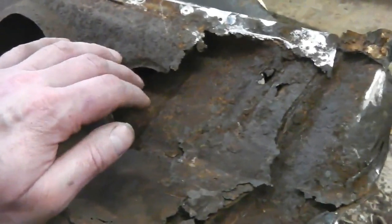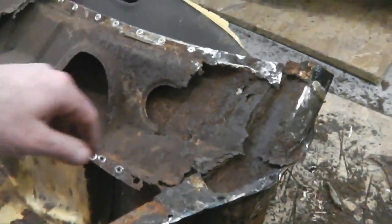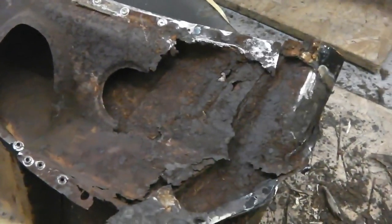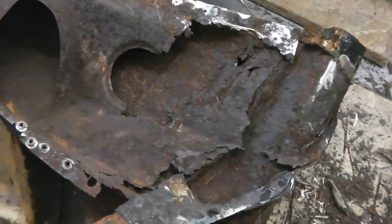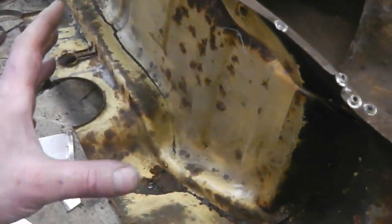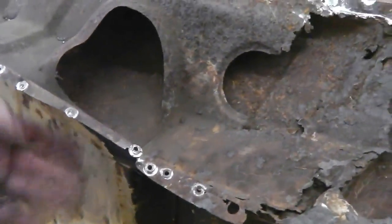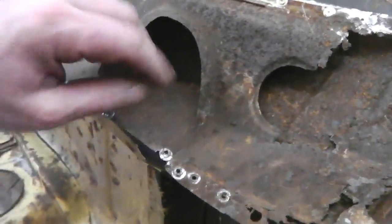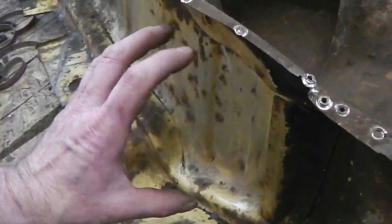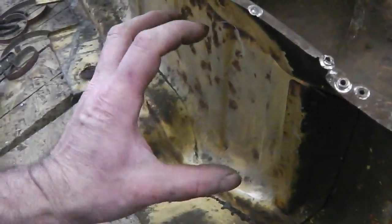So even if you've got good scuttles, you're still going to have the possibility that this inner panel has been eaten away. Now, you might not get any idea of that until you lift the scuttle. If you took your heater box off, here's your heater box in the bulkhead, you can look up with a torch through this aperture here. And that's the air intake aperture, by the way, because the induction for the hamster wheel or the cage fan is there. So that cage fan's my fingers rotating round.